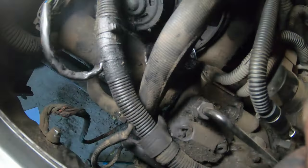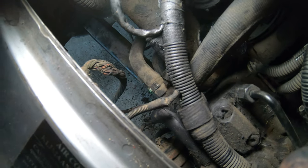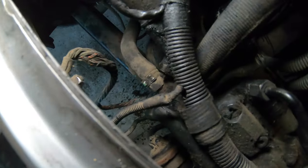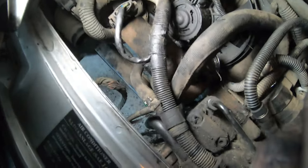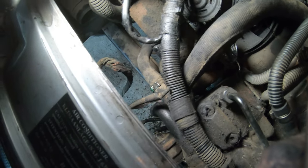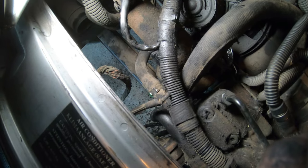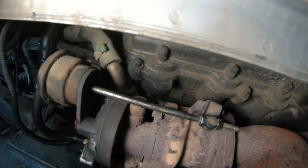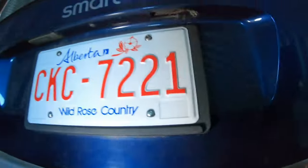I just gotta figure out how to take that thing off. It's such a small motor and such a small amount of exhaust gas going in. I guess, you know, that could be the EGR cooler there. Just the pipe running into the EGR itself runs coolant through it, and then that's the EGR cooler. Makes sense. Yeah, it's definitely easier to block that off on the EGR side. So I'll pull that off on the EGR valve itself.